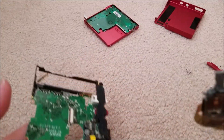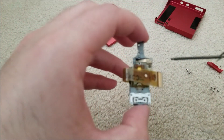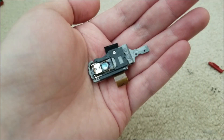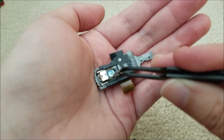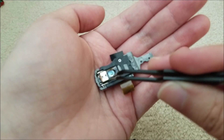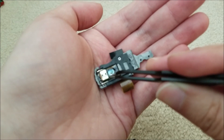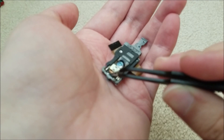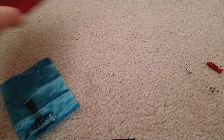The entire laser comes with the lead screw, so I'm just going to carefully remove the worm screw. And here's the old laser module. You can see the old lens — the actual lens floats. You really shouldn't do this with a good lens, but you can see mine: the actual springiness of it is probably not so great, and that's why I'm having trouble with skipping and reading discs. Anyway, just going to set this one aside.